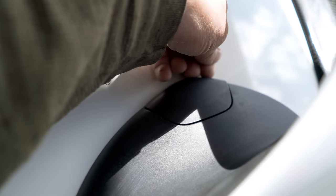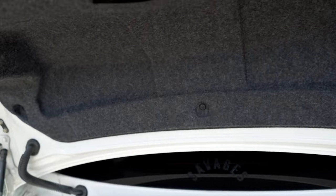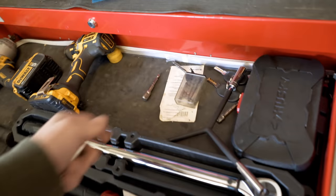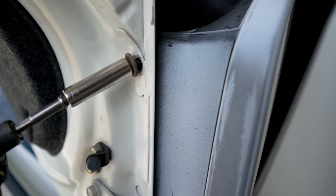Open the trunk — this wing should take about five minutes to pull off. There are little black plastic covers right here. You can pop those off and set them to the side. I really like how this car looks with the stock wing, but some prefer wingless and a lot of people prefer the big wing like myself. Stock wing looks amazing but the big wing, you can't beat it. The only tool you're going to need is a 10 millimeter socket — I'm going to throw it on my little quarter inch impact. Pull off these two on the bottom, there's going to be one here, a little bolt there, and then a nut up top. Don't worry, it's not going to fall yet because there's still a bolt on top holding the wing to the trunk.